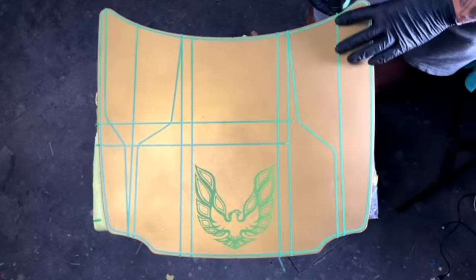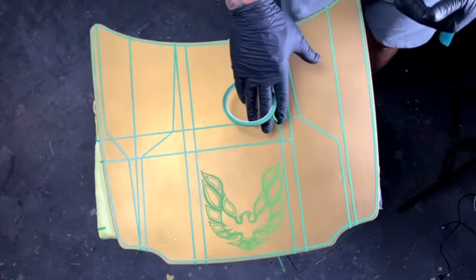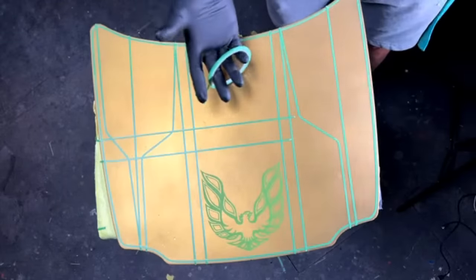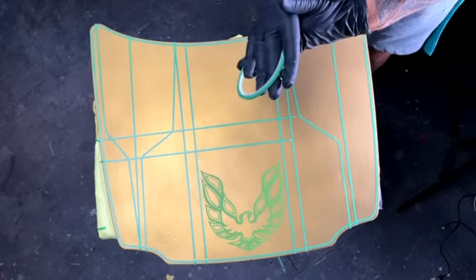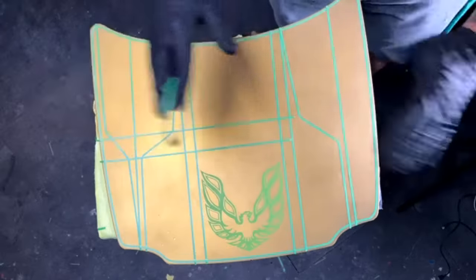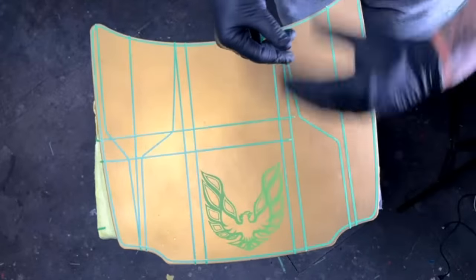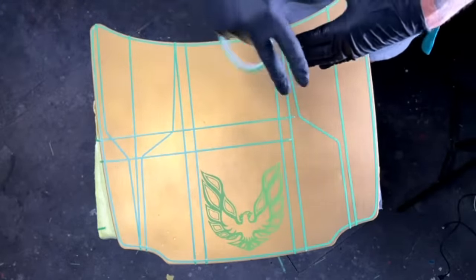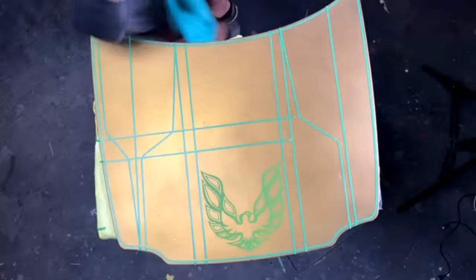Wet-on-wet means you're laying down the primer, letting it flash off, and that primer stays open long enough that when you lay something else on top, there's going to be a chemical adherence to that. Or you can let the primer dry and sand it smooth, and when you're sanding it with at least 600 grit or whatever, the next layer will etch in mechanically and bond that way. So it works either way.